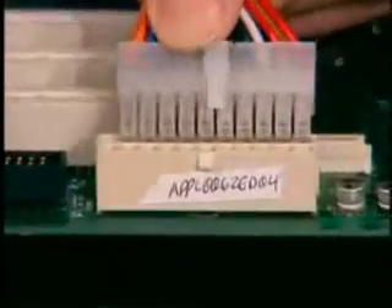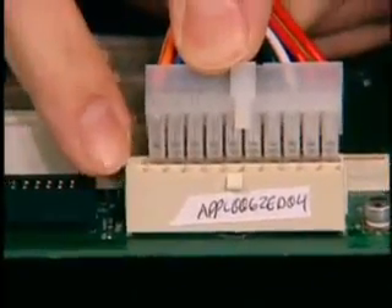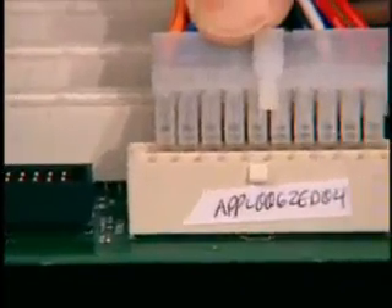This looked like a nightmare to find. This is a special Macintosh power supply. This one I'm showing here is a standard ATX power supply — the Macintosh one I actually purchased is in the machine. If you take a look at the connector on a standard ATX, it's a 20-pin connector. You'll notice there are two extra pins at the end that Apple has added, and I'll tell you why they added those later.